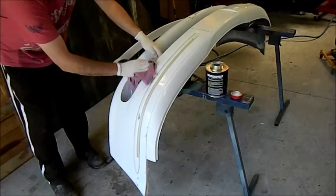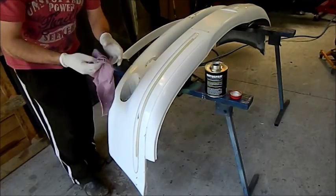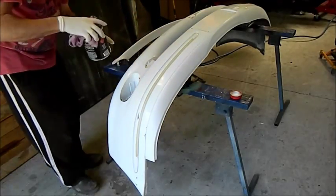It's quite a warm day today, and I can use a retarder in the thinner. Acrylic paint goes off very, very quickly, and you can slow that process and let it flatten out by using a retarder. I'm not going to do that though.